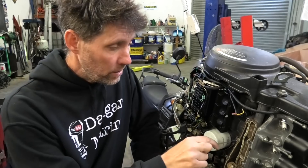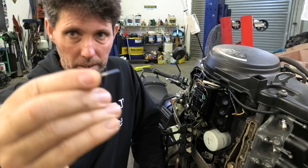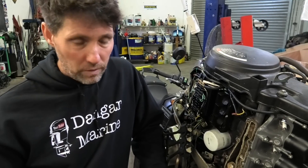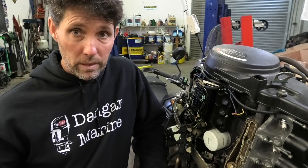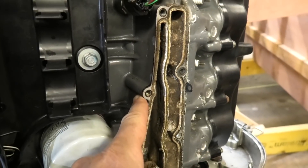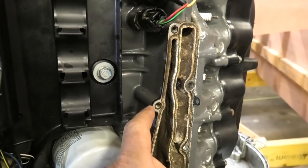Step one is to drill the hole out. Before starting, I just have a look at how deep the actual thread is by putting in an old tungsten drill bit to check. There is a bottom to this hole — some bolts go all the way through into a water jacket, but in this case it's a closed hole. I'm going to mark the drill bit so that I don't end up over-drilling too deep into the block. Around here you can see there's probably loads of metal to drill deeper, but it's just something to be careful with.